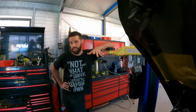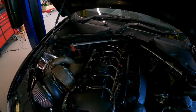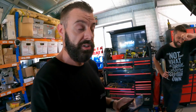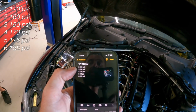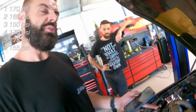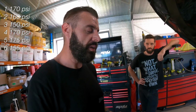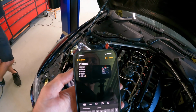Before we share the results, comment below, what do you reckon the average is? And also the lowest cylinder, because this motor's put the work in. Anyway, compression was actually pretty good. The lowest cylinder is 150 psi, which is number 3, and the highest is cylinder 5 at 175. That was done semi-warm, warm enough that you could touch the block but not burn your fingers, and we just cranked it until the compression gauge basically stopped moving. All in all, we're talking like a 15% variation.